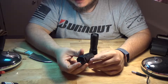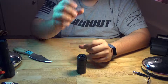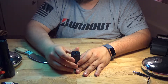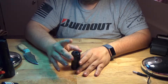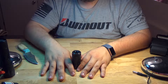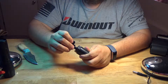It says it's 1 and 1/16ths, which is correct, but much shallower. This is a very specific kind of socket. If you're looking for this for the 5.3s, 6.0s — those engines — this is the socket you want to replace the sensor, because those sensors go bad. Like on my brother-in-law's truck, we probably replaced it but the oil pressure was still reading low. I noticed it was off the sludge — the guy had almost maybe two quarts out of a six-quart motor. Hopefully he's staying on top of those oil changes, but it has its moments.